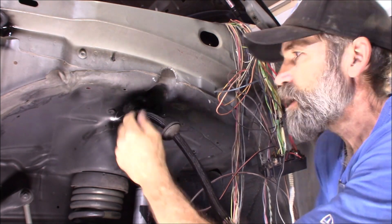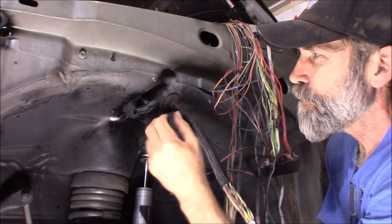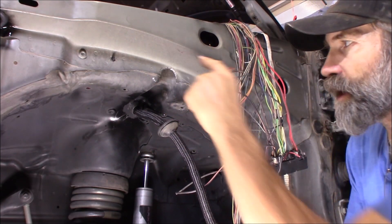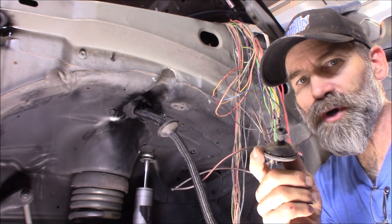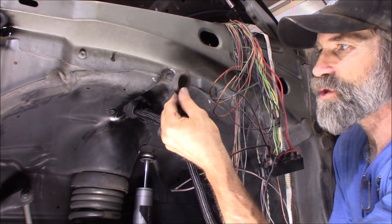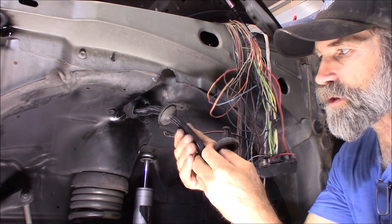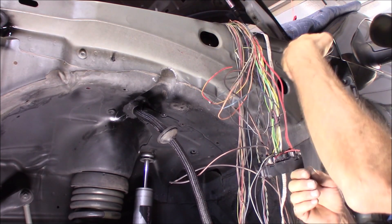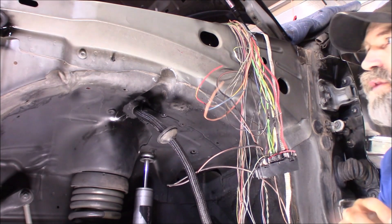Now that we've got the grommet installed here, in this section the metal used to go across, so I want to take this harness and lay it up in here like so. I cut that out with a hole saw and beat it down so there are no sharp edges — gave it a nice rounded corner. Using this grommet — the one that was up here in the cowl for the wiper motor — I won't be needing it anymore because those wires are going to come directly into that cavity. I'm going to drill a 1-3/8 inch hole right here to get into this cavity, and with another harness coming in here, I'll bring both harnesses out to where I'm going to make my splice and then pull it back in. I went ahead and shot some black paint in there to keep anything from rusting.